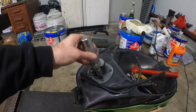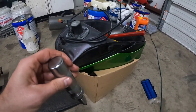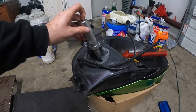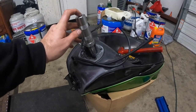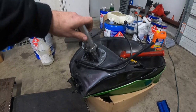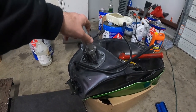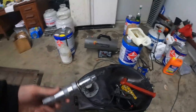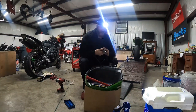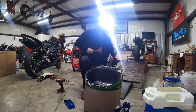Here's one of these impact drivers — you use it like a ratchet. It goes on top of your screw and you hit it with a hammer. Basically it's forced down as hard as it can, and as soon as it gets to the bottom it turns and loosens it at the same time — pushes down hard so it can't slip, then bites and breaks it loose all in one shot. We're going to get these out hopefully without running into any more issues with the pump.